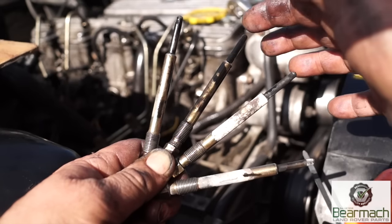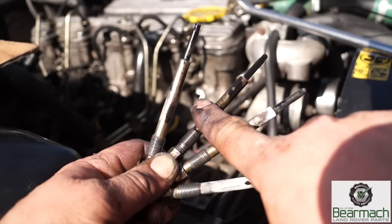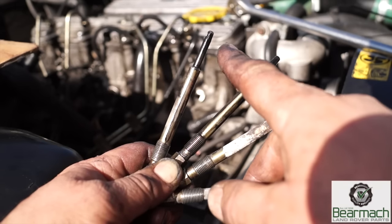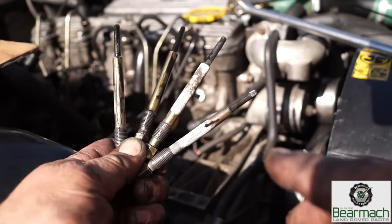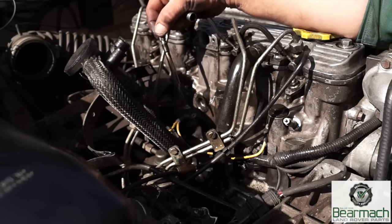So we're seeing that if there is any oil in the cylinders — number three has oil whereas number two and number one haven't. This glow plug is fairly oily, and so is number four. So we're suspecting that oil is getting up into the cylinders via the piston rings. This check could actually be a little bit deceptive if oil is sitting on the cylinder head itself and you pull the glow plug through it.